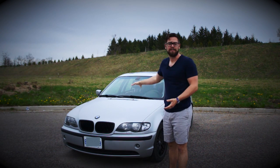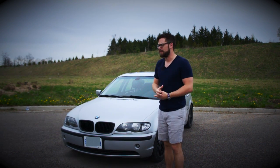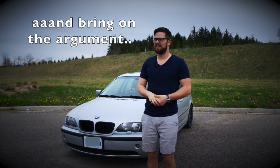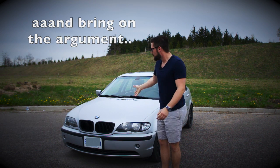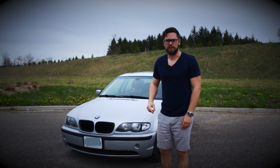You have to do an aftermarket exhaust system so that you can still meet emissions regulations. After that, some people say a cold air intake is going to give you a few horsepower. Nah, not really. Who cares? Use the stock air box and put a fresh air filter in it. It's very well tuned from the BMW factory.